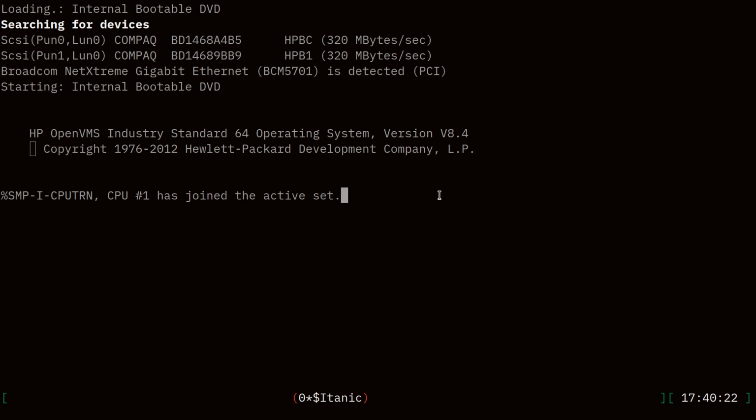Every instruction encodes one operation. That could be add two numbers, or load a value into a register, or branch if the condition bit is set or unset, things like that. And so every computer program gets decomposed down into these discrete, kind of small minimum operations, and then you string lots and lots of them together, and you have a working computer program. The idea behind this very long instruction word architecture is that a single instruction can contain multiple operations, and the CPU is able to execute some of those operations simultaneously.